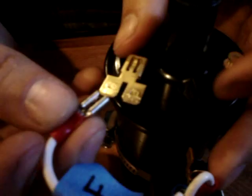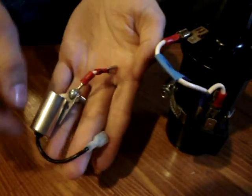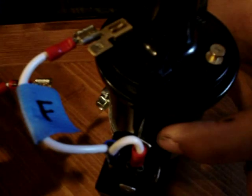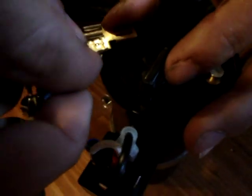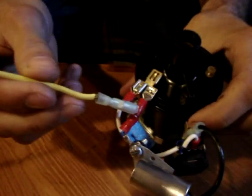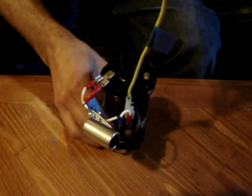Attach section F just like that, and this one will attach right up here. Next, take the capacitor with section E and attach the capacitor side to one of the pins going to terminal 30 on the relay — use this one right there. Then attach the other end to the other positive. Now take section D — take the female side and attach it to the last terminal going to pin number 30, and for now that just hangs in the air.